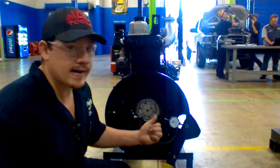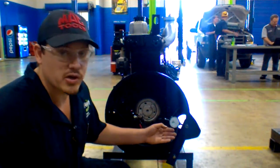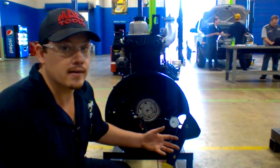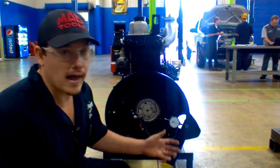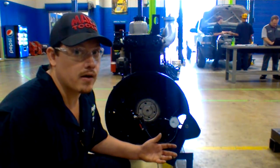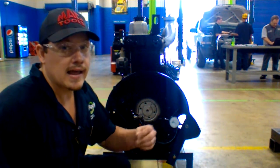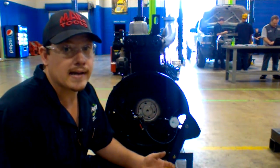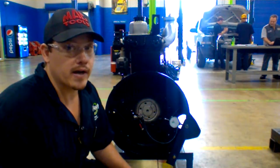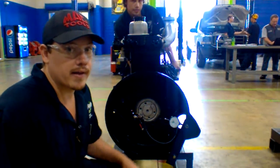As of right now I can maybe get a quarter of a turn out of it, but it will demonstrate what the tool is going to do to show you the difference of the run out. I don't have the specifications on me for the run out, but you can go in the manual about page 139 and the specifications are written there about what you're looking for. So I'm going to get my buddy Jeff over here — he's going to go to the backside of the engine and turn it a little bit.